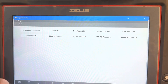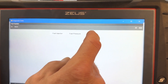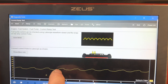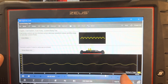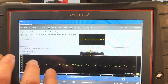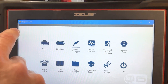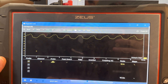What I'd like to do is go back to the guided functions. Let's go back into the engine again and let's see what it looks like with the new pump. Much better than it looked yesterday — remember yesterday we had those big wide gaps and it really didn't pick up a whole lot. Today we've got humps. I still wouldn't use this to diagnose the car, but it's much better. This would get you set up — you can use this and then go over to the other scope, note where we are: 10 milliseconds, 20 amps, then go back over and use that for your setup.